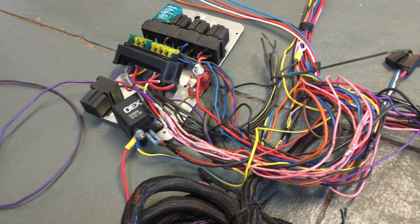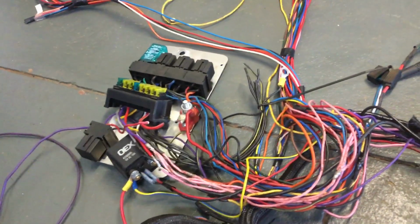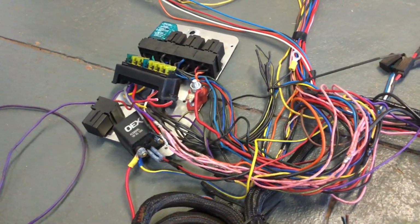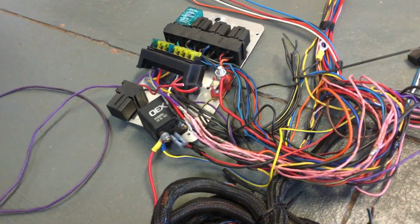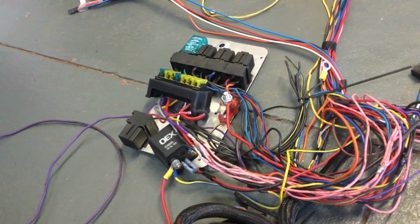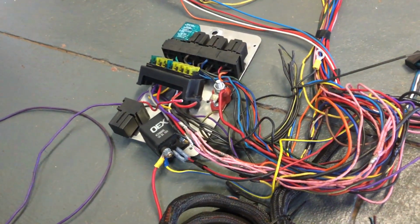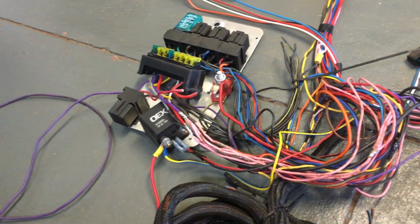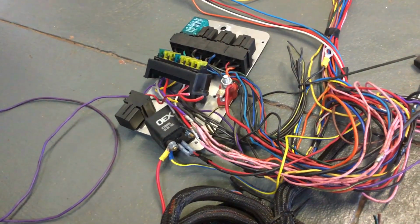But when the car hasn't been ground correctly, the easiest way of explaining it is you don't have the spark that you need. You don't have the right spark to start the car. You don't have the right spark for how it was tuned on the engine dyno when it had full spark. So you end up having a car that when it does start, if and when, it would foul the plugs, and when driving it, the plugs would end up black and sooty.